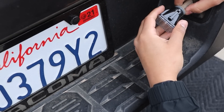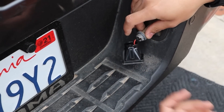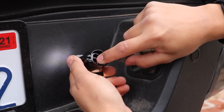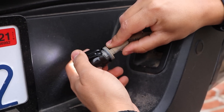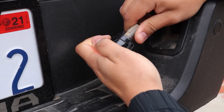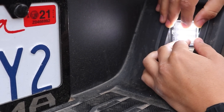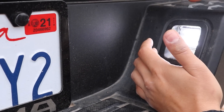Before you connect everything back together I would highly suggest you test it out, just in case it's polarity specific. Go ahead and turn these on. Now that you can see it works, notice there are grooves — little cutouts, three of them — and on the actual harness there are cutouts as well, so it only goes in one way. You can't really mess this up. Once it's inserted, turn it clockwise and you're basically done. Check the connection, make sure it's not going to fall out, and then reinsert. Once you hear the clicking it's locked in.